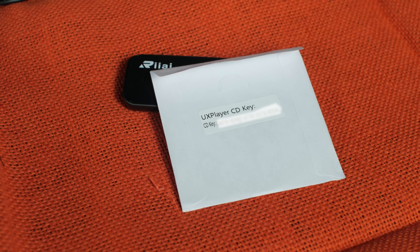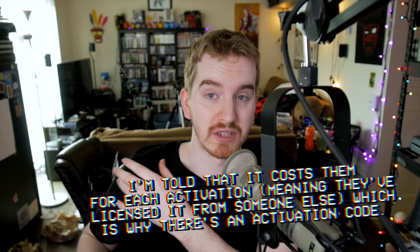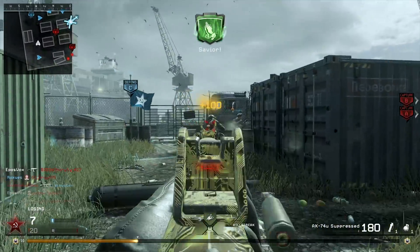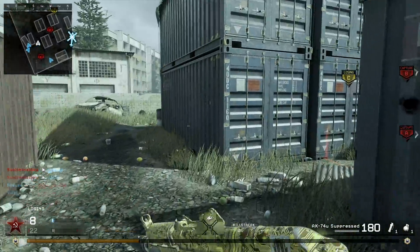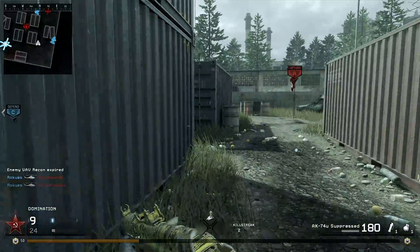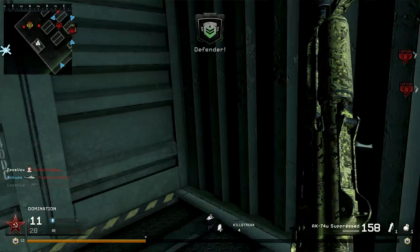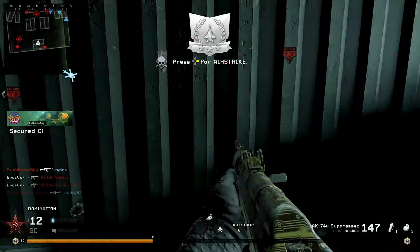In the box you also get the micro-USB 3.0 cable and a CD with drivers, plus a license key on the manual. My major complaint is I can't stand it when software purpose-built for a piece of hardware requires a license key, because if you lose it you won't be able to use it — and there's just potential compatibility issues. Despite being supposedly a UVC capture card compatible with Mac, Windows, Linux, and smartphones, I had issues getting it to recognize on computers without installing their software and driver, which is unfortunate.